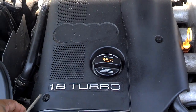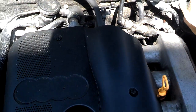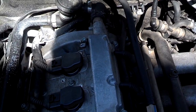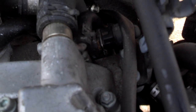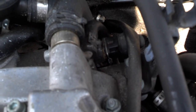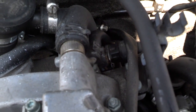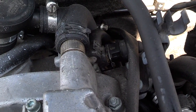I'm going to twist these a quarter turn and remove this cover from the top of the motor. On the back of this cam, there's a plug — I believe that would be the cam sensor. Normally, if you unplug a cam sensor, that will deactivate the fuel system and the ignition system. So I'm going to go ahead and unplug that.